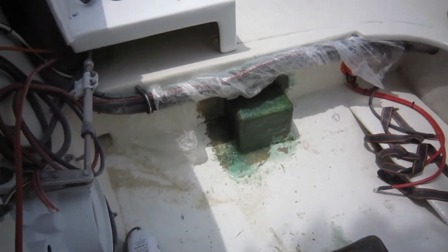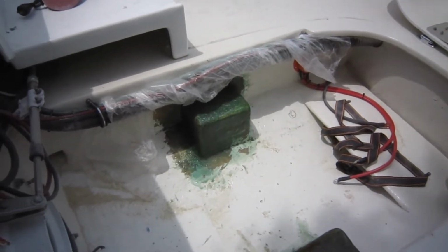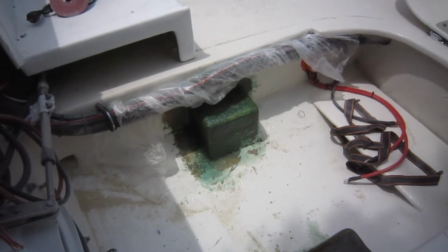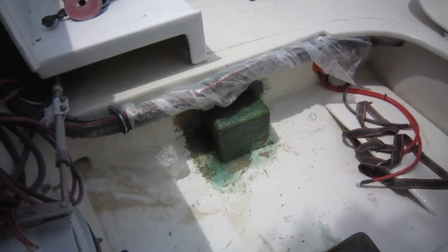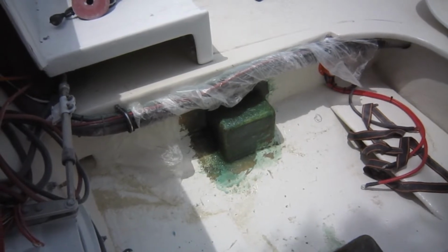Best thing to cut fiberglass with is a metal disc on a disc grinder, just as an FYI. And it took a 2-pound maul and a big chisel to get that to break off. So it was like pounding on the hull too. I was regretting every second of it. It was like, oh, no gel coat cracks, no this, no that.